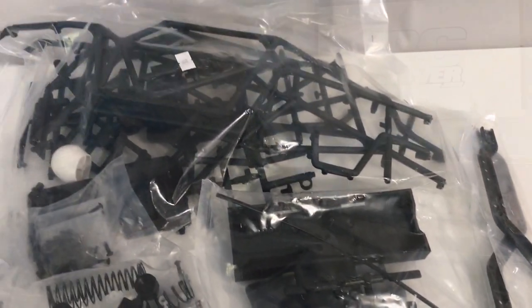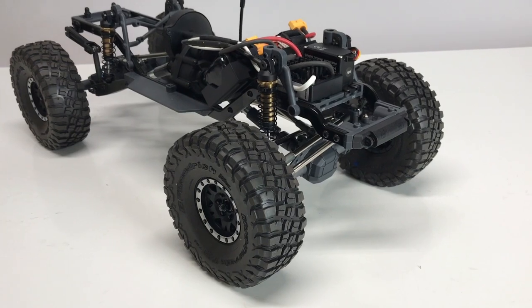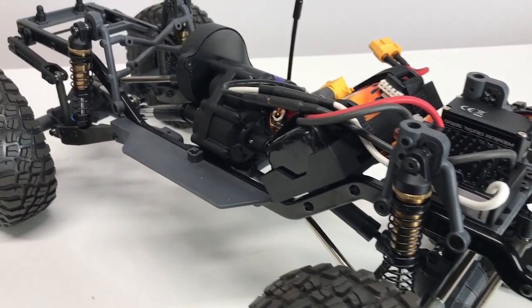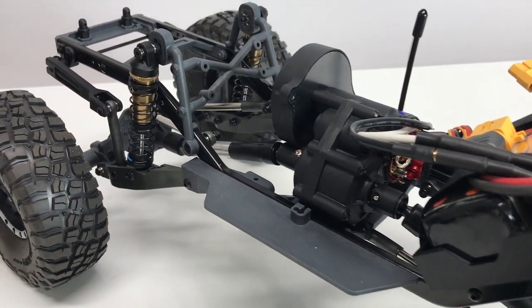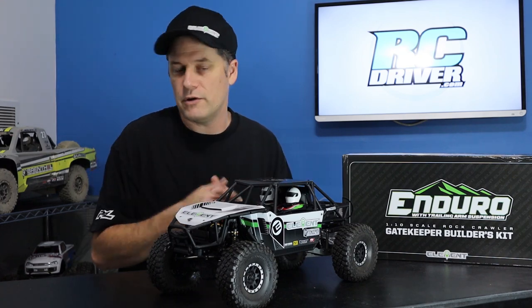We also have the Enduro driveline on this. So we've got their front axle, rear axle assembly. It's got the hard plastics for the axle, ring and pinion with helical cut gears in there, ball bearings, of course, throughout, universals in the front. And in the center, we've got the Stealth X transmission still, which is the tunable transmission. You could change the overdrive, underdrive, go 50-50 with it.